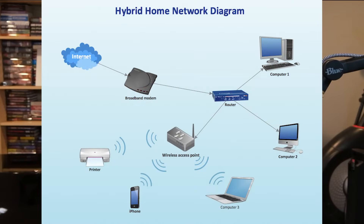Let's talk a little bit about what this device is and what it is not. First off, it is not a modem. This does not terminate internet coming into your home and it doesn't in any way replace internet service. It's not a router. It doesn't do any IP addressing, DHCP, or security services. What it does do is broadcast and receive Wi-Fi signal connections to devices.